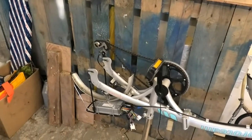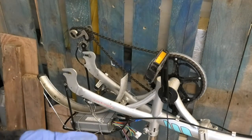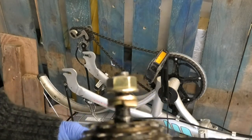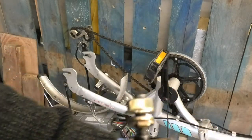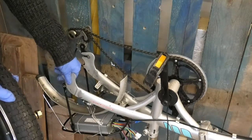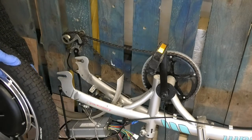I did struggle a little bit with the valve, which is a bit too close to the hub here. So I would recommend getting an inner tube with a valve that has a 90 degree angle, basically. But nevertheless, I'll just get in there. So now, ideally, I'm going to try and get this wheel fitted. And like I said, this nut there — it's got two flat ends, it's not round, which means it's got to fit in here in a certain way. But it's not really an issue.